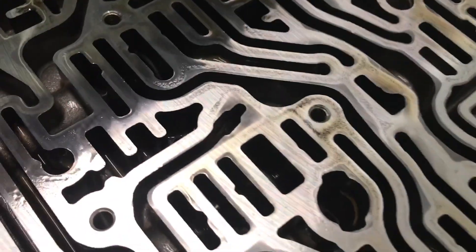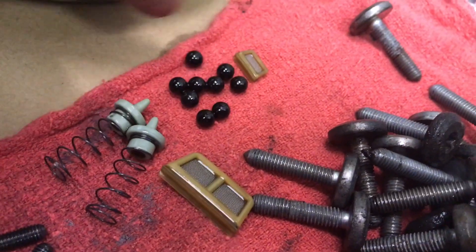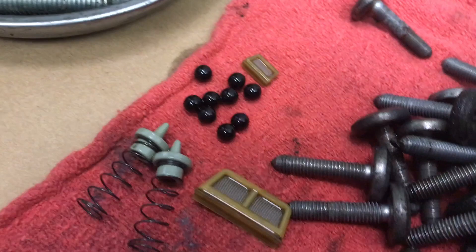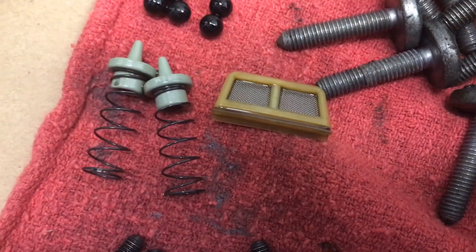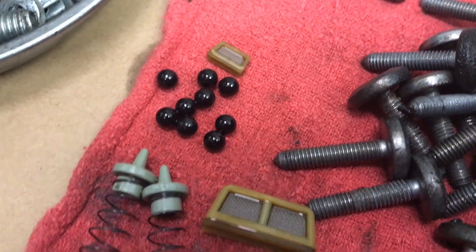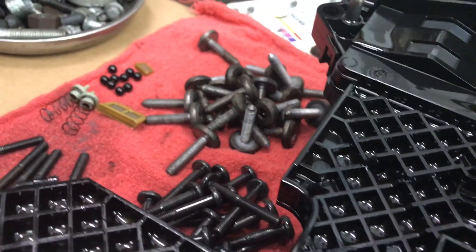The pressure on the actual clutch checked out okay. These are all little maintenance items we replaced with the zip kit — two filters, some check balls (the check balls get smaller in diameter over the years), and those two little pointed valves are leak-down valves for the torque converter clutch so it holds fluid when the car is shut off.